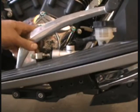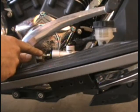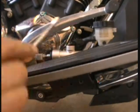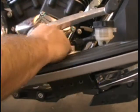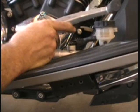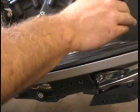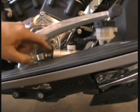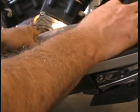Everything's loose now. The trickier part is this adjuster here. What this adjuster allows you to do is you back this jam nut off — which is a 12 millimeter nut — and that lets your pedal go up higher. If you want to put your shoe in a different spot, or maybe you like it higher, you want this down lower — that's what this adjustment does. You back that nut off, and then this hex here for a wrench, you just turn that and it'll screw your pedal up and down. When you're all done, you just lock it together.